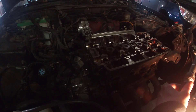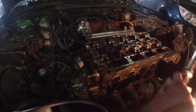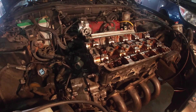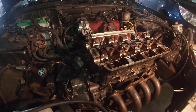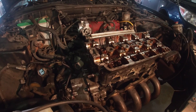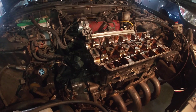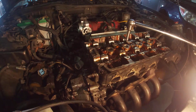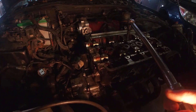Reading about 55 - normally they give you a chart but for some reason there's no chart. It's 80 foot-pounds, so I'm going to turn this guy up. Oh yeah, so 80. There we go, right there - lock that guy back on and we start our final torque process.